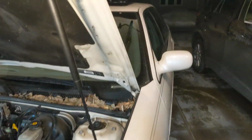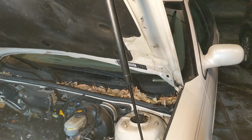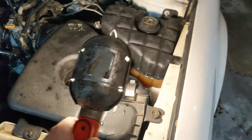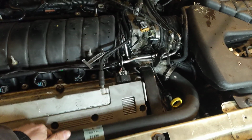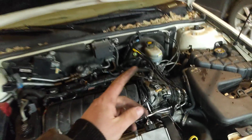But it only went 1 notch high. And from what I read online, that's common. It goes 1 notch high, and then I had no heat in the car. So there's just not enough in there yet. But it sucks because to run around the block, you gotta put the cap on, and then it's pressurized. So now I gotta wait for it to cool all the way down, add more fluid, and go and do it another couple times, but it went up to the 1 notch.